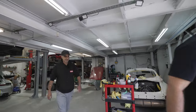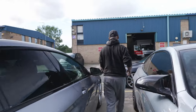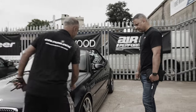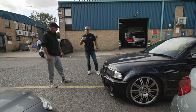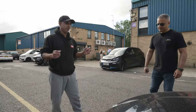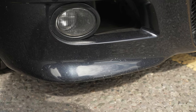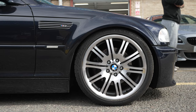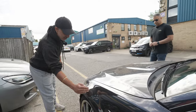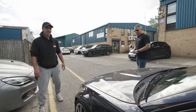Let's show you the BM. Now the car's dirty so there's not much I can show you, but Bob did pop over to CAS HQ a couple of weeks ago, so he's got an idea of what the plans are. So just remind me and our viewers: what are the plans? Right, so we discussed the job — we're going to do a bonnet respray, a bumper respray just for stone chip repairs. There's no damage, it's just cosmetic stone chip repairs. We're going to blend it into the two front wings, so any stone chips across the front end we do, and that area there is good for us to blend out in. A nice simple job, have it done in a week or so.